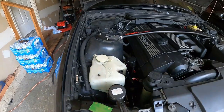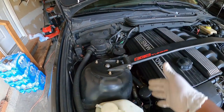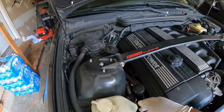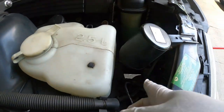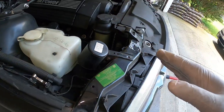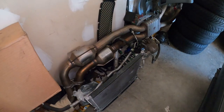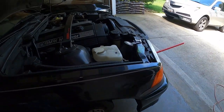To replace the AC system, since I purchased the whole AC system, the first thing is to purge the old Freon that is on the line. I've done that already — I went to a professional mechanic and they purged and removed that from the line, so right now it is completely empty. I'm going to remove the AC compressor, remove the condenser hiding under these bolts, and also remove the dryer right here. I have a brand new complete system that I purchased. Since I don't know exactly what is wrong and don't have time to troubleshoot, I want to go ahead and replace the whole system. Once I install it, I'll take it back to a shop for them to charge the AC, and after that my AC situation should be fixed.